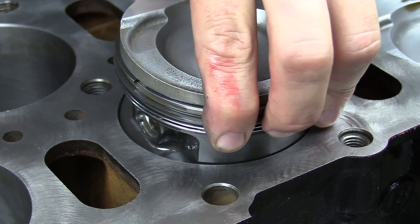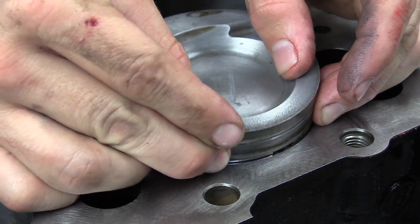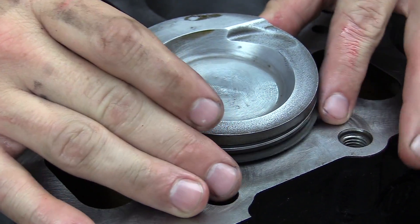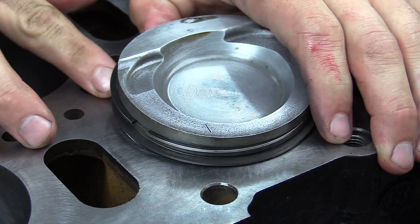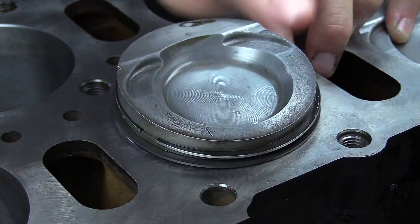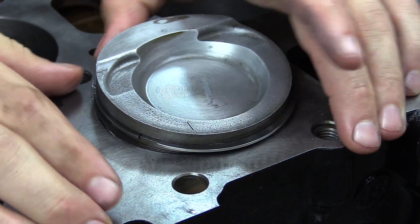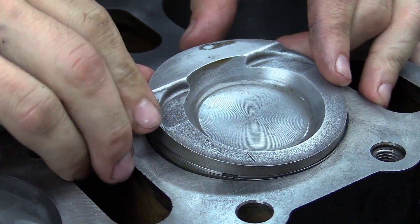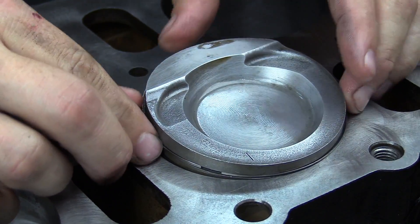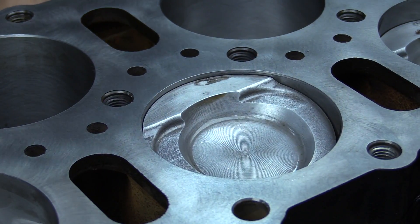Once our rings are properly clocked, we're going to install the piston, which is best done with the proper ring compressor. The VR6 block and bore are at an odd angle to each other, so the standard ring compressors don't really work that well. VW does make a special tool for this, but it works average at best. There are companies that make specialized ring compressors for this application, but I've found that doing this by hand is really not that hard — it just takes a little bit longer. You have to go slow and be careful. If you have the proper tool, use that; if you don't, installing these pistons by hand can be done.